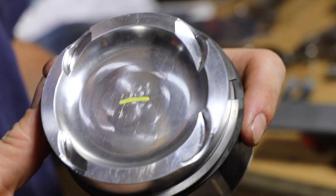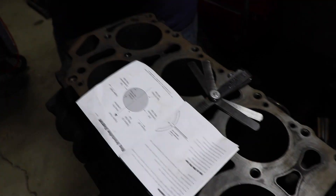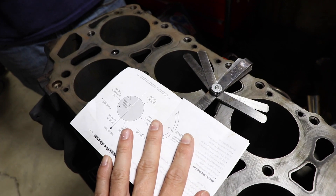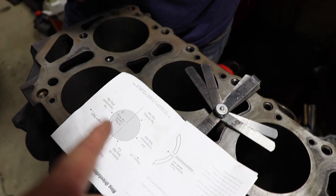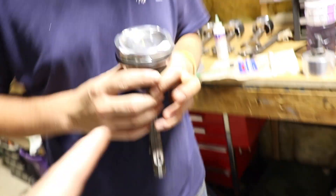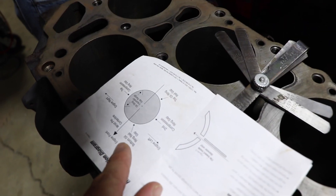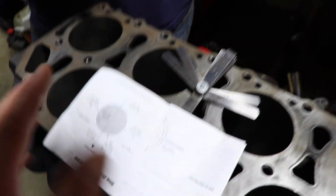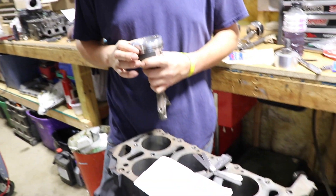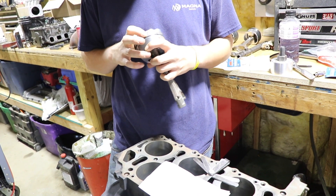The numbers need to be facing up on all the rings. Also, in the little booklet they give you with the rings there is a ring orientation diagram — they want you to put the open end of the rings at a certain orientation relative to engine front, and they want you to divide these things up so they're not together, basically so the compression doesn't just blow by.